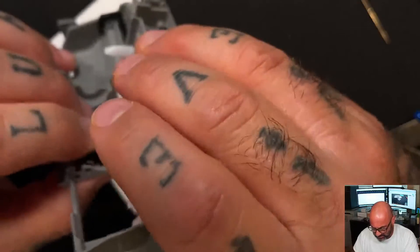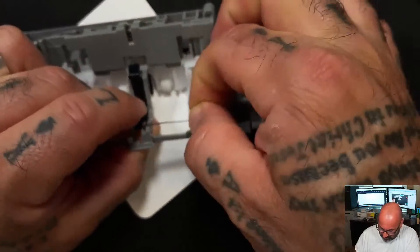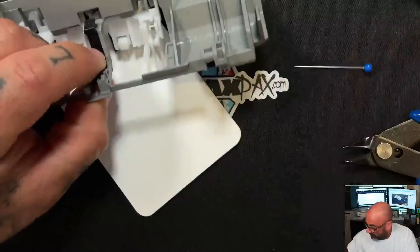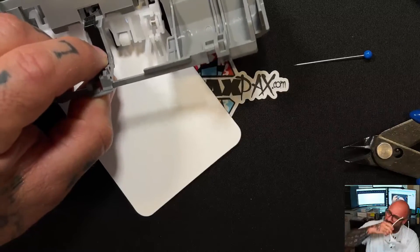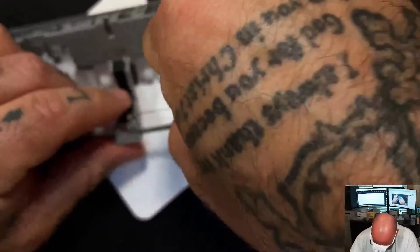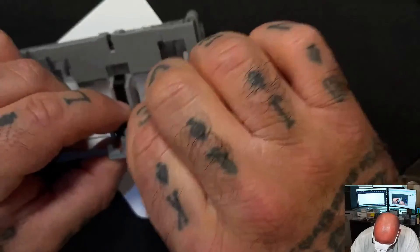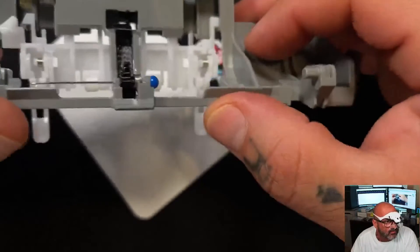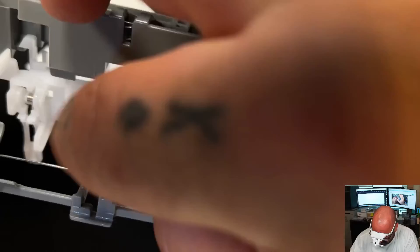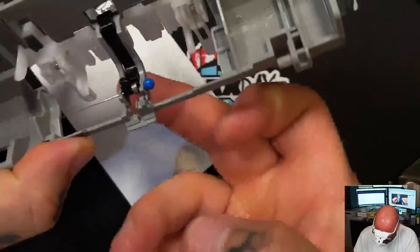What you're going to do is keep your thumb on this part so that the spring doesn't fly off, and you're going to have that little excess right there. Just put it through that hole right there — just like that into that hole. Your spring is going to go in here, in this top hole right there. Then you're going to hold the part in place and get your needle. Feed the needle through that hole, through the printed part. I usually wear magnifying goggles or glasses for this because I can't see otherwise. I'm going to feed this through — be patient because you have to feed it right through the center of the printed part. There you go. You can see where the spring goes in here and where the back of the spring is now pressed into the 3D print.